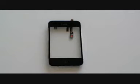These are held together with glue. To separate these, the best way to do it is to use a heat gun or a hairdryer to warm the glue to make them easier to separate. Here we're using a hairdryer to heat the glue between the midsection and the digitizer to make the digitizer easier to remove. You may wish to hold the digitizer with a hand cloth or wear a glove as the frame can get very hot. Be careful not to overheat the digitizer as we don't want to damage any components.